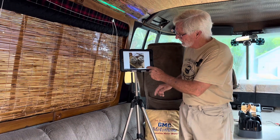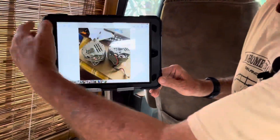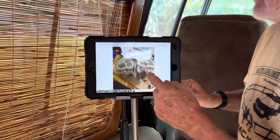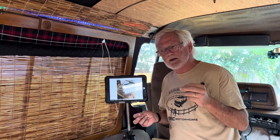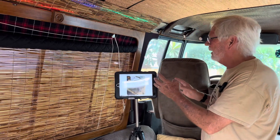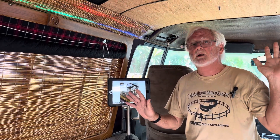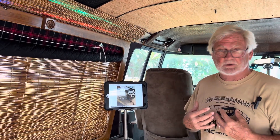Also, if your alternator has one of these red-wired connectors, take it off. This was something used in the past to block back-EMF if the regulator failed. We found that the problem is not the regulator as much as it is the trigger circuit, so there is no value in leaving that on. Certainly when you go to a one-wire alternator, that won't be used at all. If you have a three-wire alternator and you have this, I strongly recommend personally to take it out.